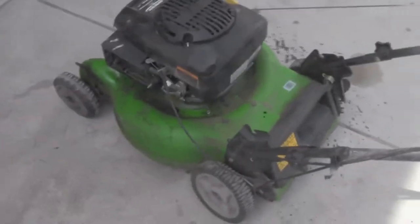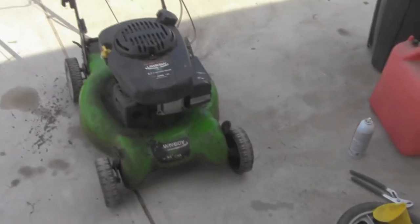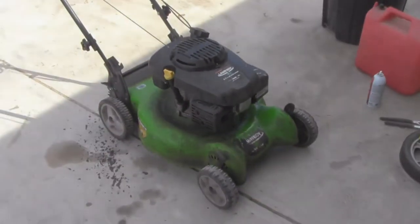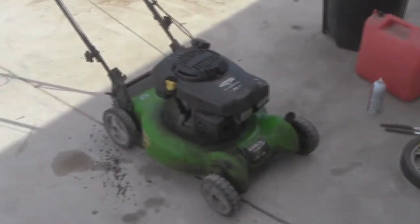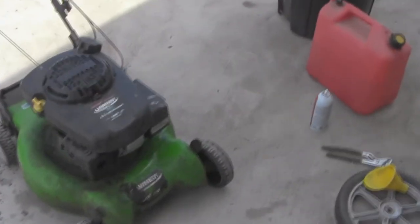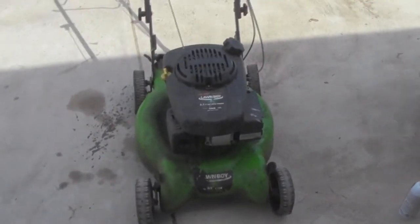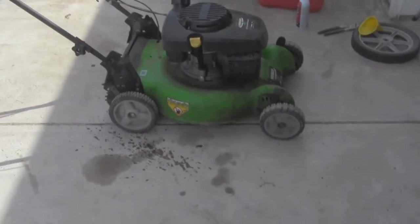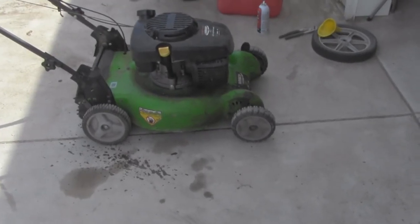This thing's definitely a write-off, unfortunately. Out of all the mowers I picked up out of that haul, this is one I wish I could have gotten going. But I still can't figure out why they pulled the valve cover off, why they pulled the carb off — it's clear that they ran over something and jacked something up. Such a shame. What's even weirder is I checked the flywheel key and it was perfect — it looked like it was the original one, like the flywheel had never even been off. The flywheel key is actually supposed to stop stuff like that from happening, but I guess they're not foolproof.